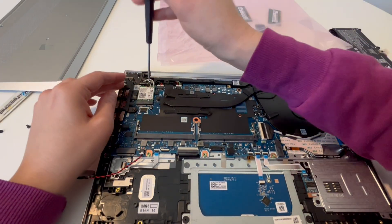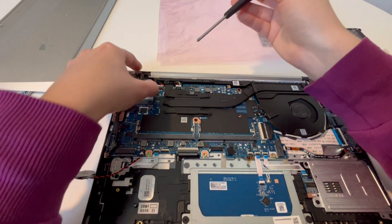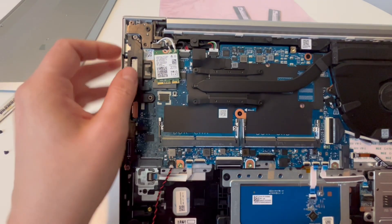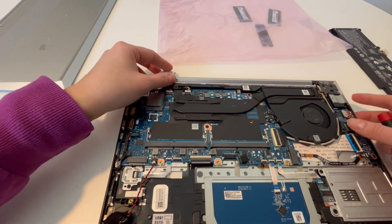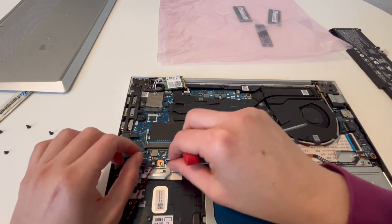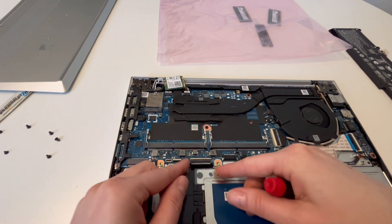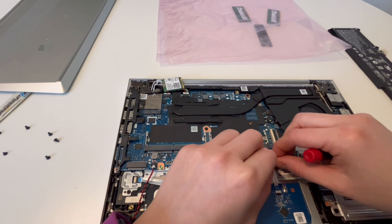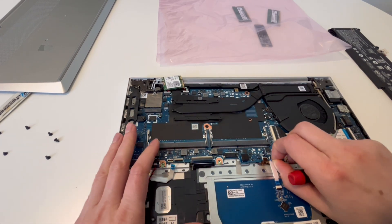I'm going to go ahead and start unplugging different components — my Wi-Fi card here. And about the BIOS reset: if you accidentally take it out, I have a video in the description on how to set the date and time if you get an error from it. See these little wires attached to the Wi-Fi card? They're really hard to reattach, so I like to just take the whole thing and set it aside with the two little wires still attached. Now I'm going to unplug all the ribbon cables very gently by the tab. See these little flaps? Be very gentle with them — they are extremely easy to break and it will ruin your life if you break them.